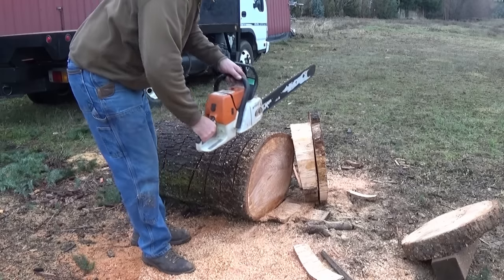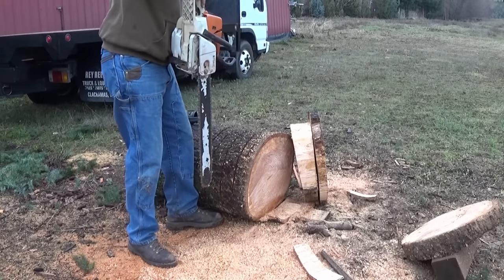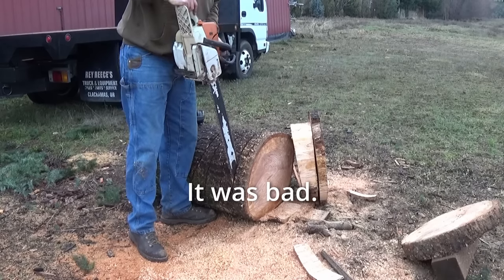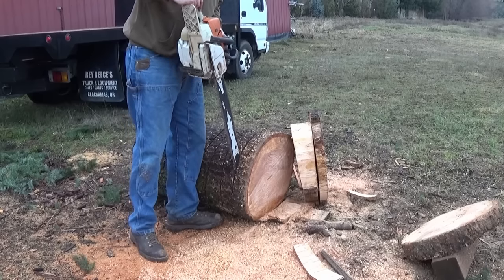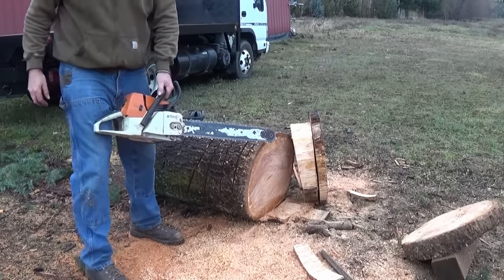You saw in that other one, after I made the cut down, you could slide the bar straight through 90 degrees. You can't slide the bar through 90 degrees on these other cuts. And that's due to the undressed bar cutting curved cuts, making it real crooked inside there. If your bar's not dressed right, you'll never cut straight.